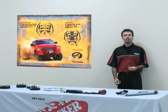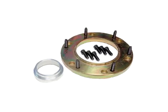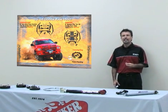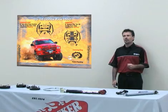The reason you don't have to replace the front drive shaft with Skyjacker suspension is the indexing ring. This indexing ring goes in between the transmission and the transfer case, re-indexing or rolling the transfer case down, so you do not have to replace the front drive shaft.